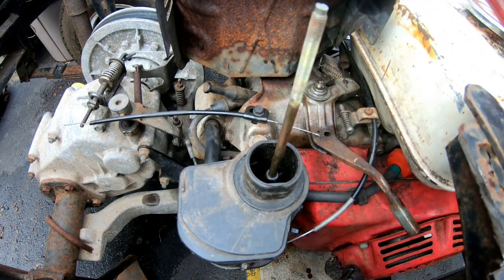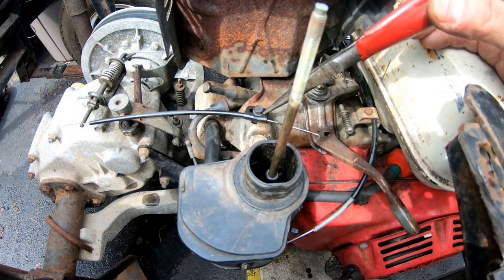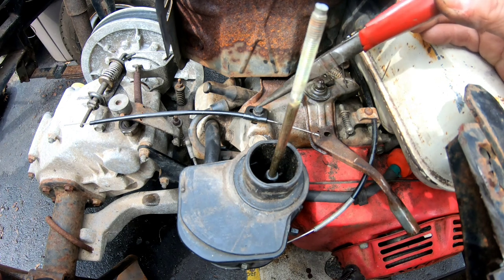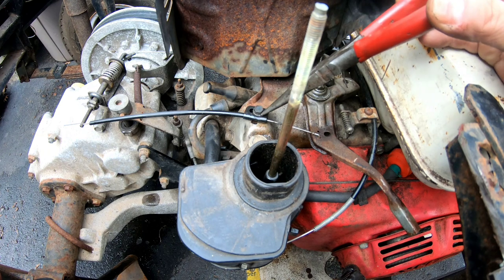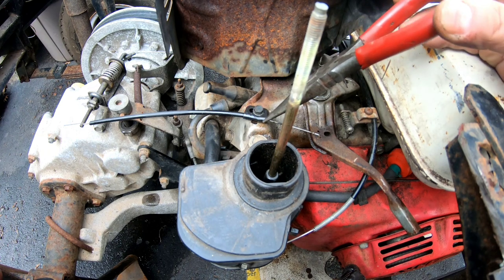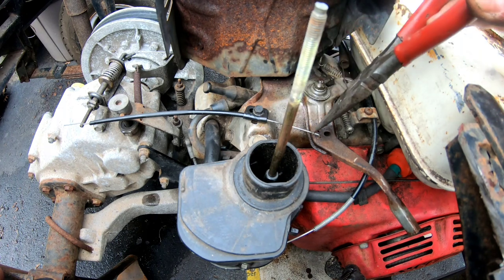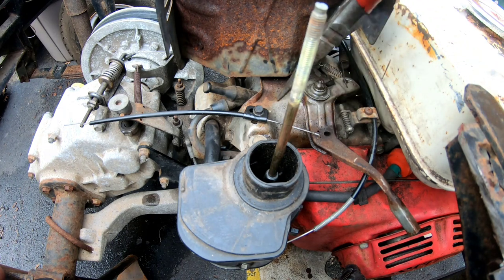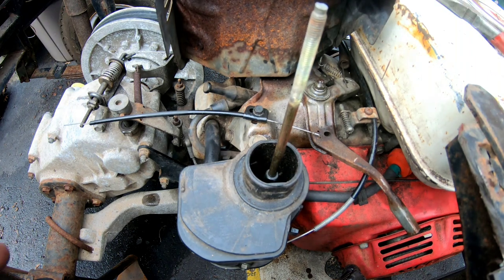Okay, I've been at this for a while. So I got an old lawn tractor throttle engagement cable. It has a sheathing here to protect it from water or whatever and rust. I oiled it with some lubricant inside, cut it to length, did a Z-bend so that it goes here, and then did a Z-bend into a hole that was in this stud already. That was a pain, as you could imagine. So anyway, here I am.